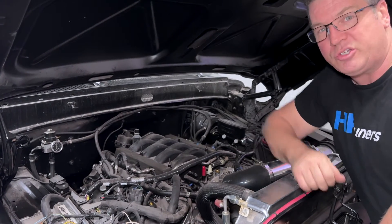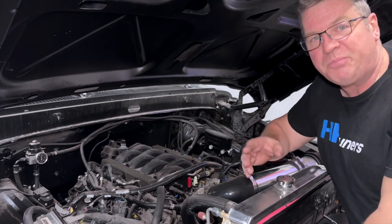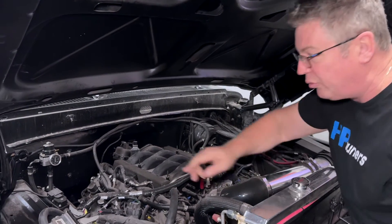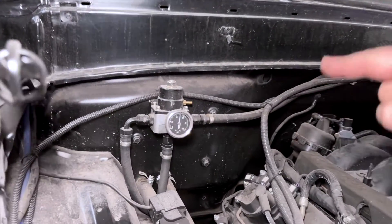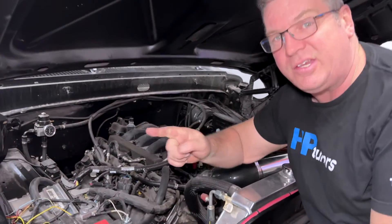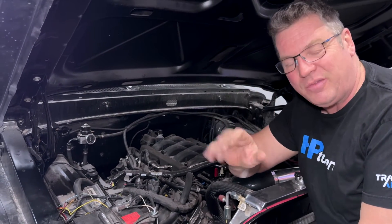It's running pretty good so far. One other point of interest: the package comes with a specific fuel pressure of 60 pounds. So if you're doing a swap, this is a great thing to have — a fuel pressure regulator set so that as soon as you turn the key on it stays at 60 pounds and simply maintains that fuel pressure.